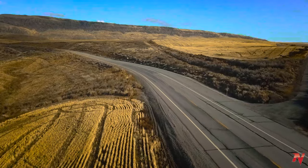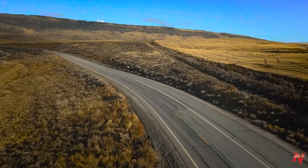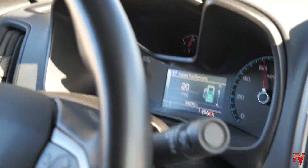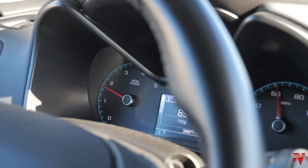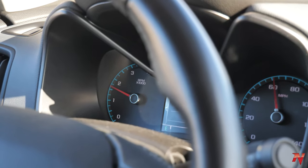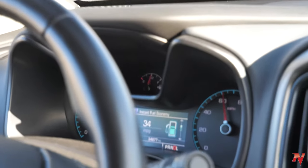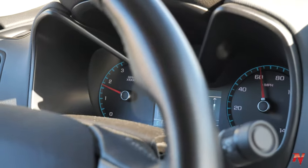So what are we hoping to gain with the 4.10 regear? It's running 3.42s from the factory. With the diesel, the gears are fine on the highway doing 60 miles an hour at low RPM, but they're not great for pulling a trailer. We do a lot of pulling with the boat. Right here at 60-62 miles an hour we're just barely over 1,500 RPM. The diesel has the torque to pull a load, but you sacrifice fuel economy. Right now without a trailer it's showing 34 miles per gallon, which is great. The minute I hook a trailer up, we drop down to 18-20, and hit a hill and it drops significantly from there.